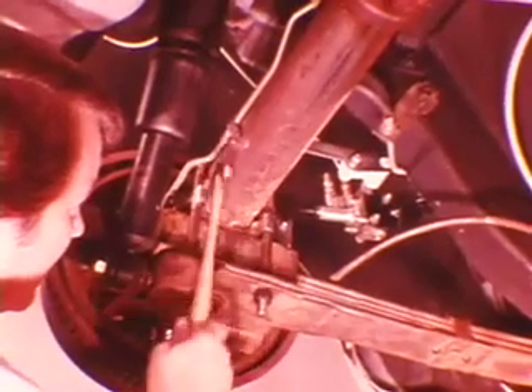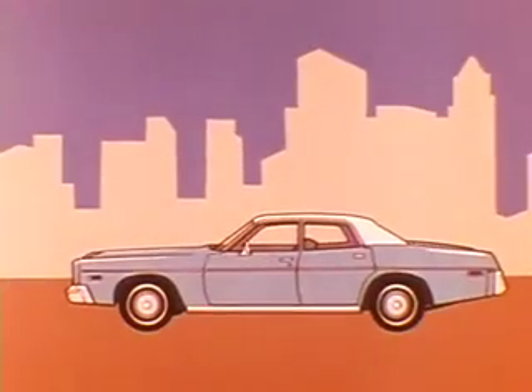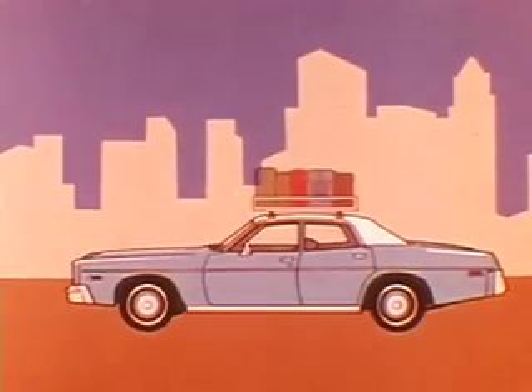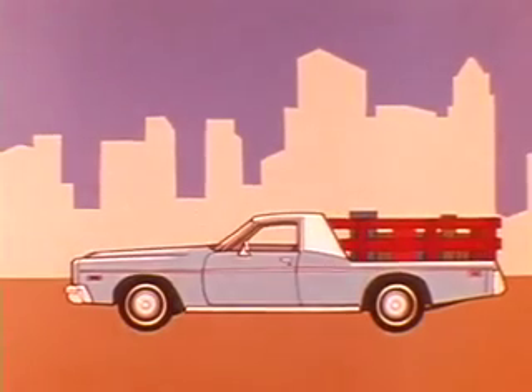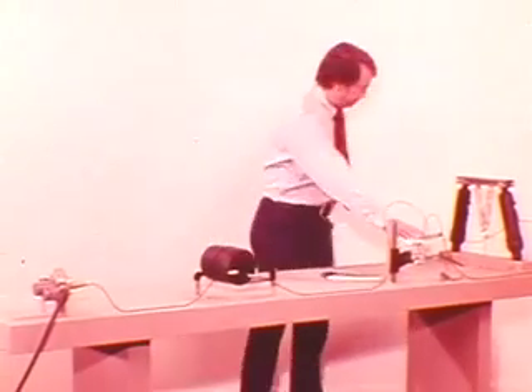That winds up our diagnosis. Now, for a few important points. When an owner is having a weight-distributing, equalizing-type trailer hitch installed, review the details outlined in the operator's manual and reference book. Trailer-loaded weight and tongue loads must not exceed the recommendations listed. Overloading, with or without a trailer, will damage the system — it's not meant to increase the load-carrying capacity of the car. Remember, it's a great feature for 1975, but certainly not designed to change a car into a truck. In order to keep the automatic height control system in tip-top condition, recommend a yearly inspection of these units. Doing so will help to provide dependable performance of this new comfort and convenience accessory.